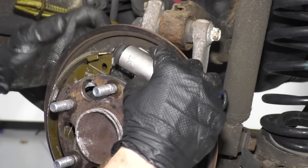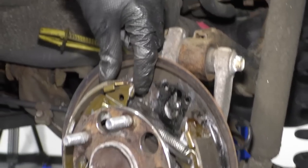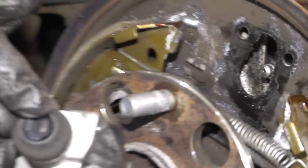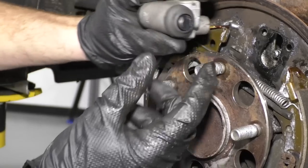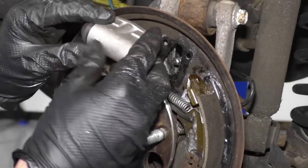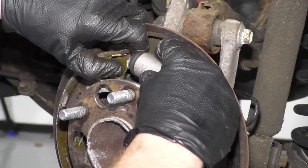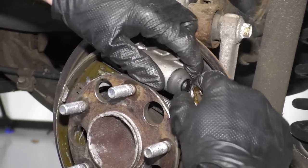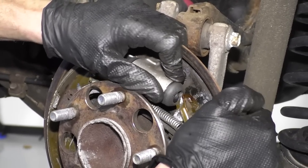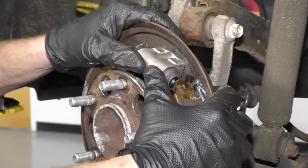We're going to come in from the top and slide the wheel cylinder in. Right here and right there is where the wheel cylinder pistons are going to ride — that sits right inside the wheel cylinder piece. If you have a little silicone paste and you like to use it, you can put a little bit on those contact points — that's completely up to you. I'm going to go from the top, pull this shoe, and it sets right in. Come over here, pull the other shoe — being careful of pinch points, safety first — and get it in there. Perfect.